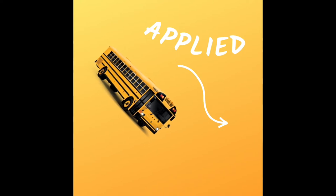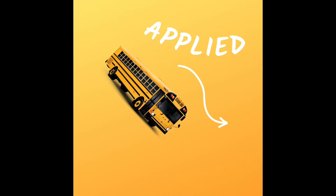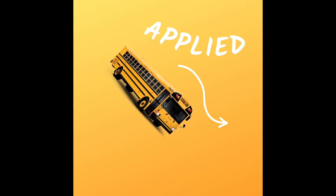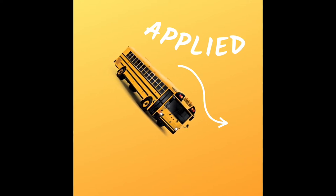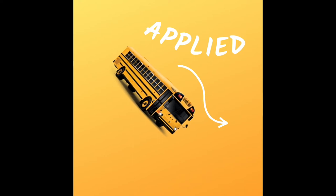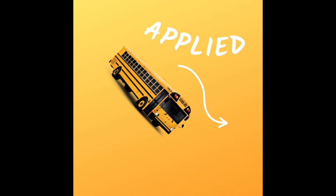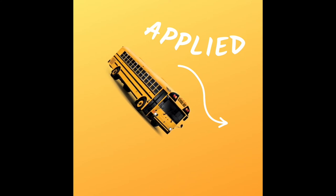Applied test. Release your park brake and press your service brake almost simultaneously. Hold your service brake for one minute and watch your gauges. You should lose no more than 3 psi in one minute.